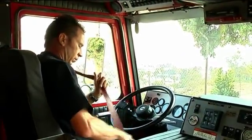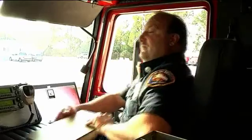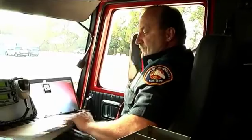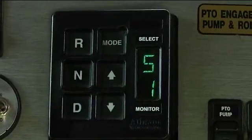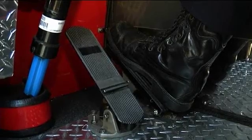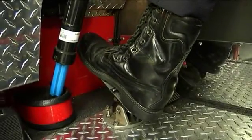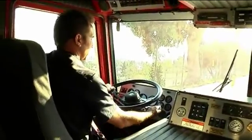Candidates shall state to all passengers: buckle seatbelts. Put transmission in D-drive. Accelerate foot throttle no more than 1000 RPM and gently tug against emergency brakes. Tug test — column trolley brake. Apply service foot brake pedal. Release emergency parking brakes. Simultaneously apply trolley hand brake valve no more than 30 PSI.